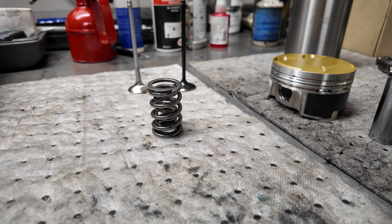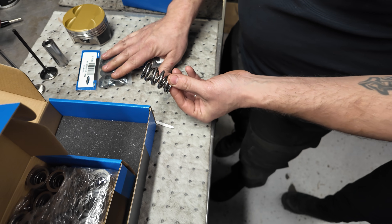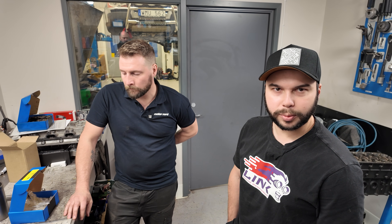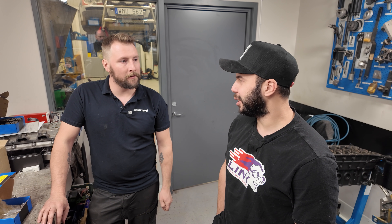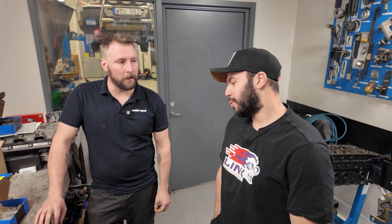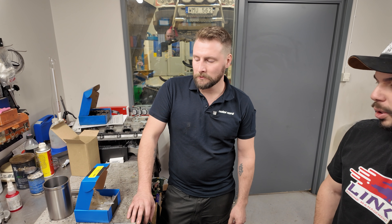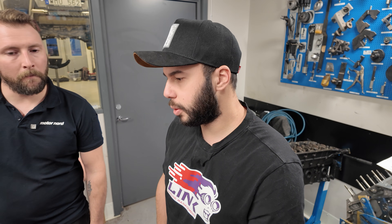Supertech's dual spring kit — that's good for nine and a half thousand RPM. The plan for this engine is to be in the 700-800 horsepower range. A lot of people building similar engines spec them for a thousand horsepower, but we prefer to build it to the level we actually need. We can't go much higher anyway because of the class rules, so we're stuck at that power level. That should be a safe margin — if we were to push this to a thousand we'd be discussing stroking and more complex builds.